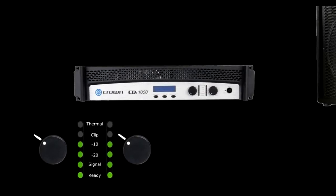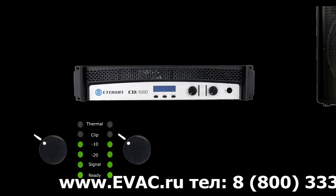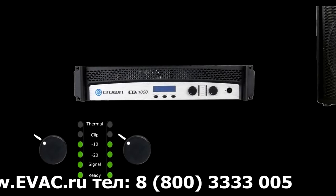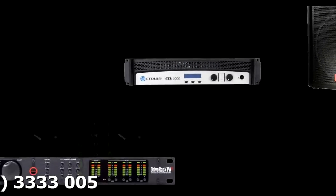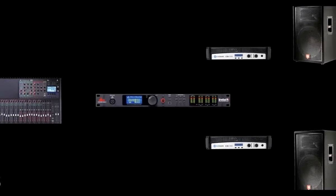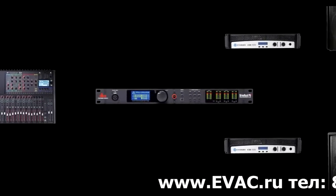Adjust your amplifier's attenuators until you reach the desired performance level and have a good blend of highs, mids, and lows. You want it to be as seamless and flat as possible. Remember, you cannot raise the attenuators past the mark that you made, so you'll have to pull the louder frequencies down. For example, if there's not enough bass, lower the mid-high amp attenuators.